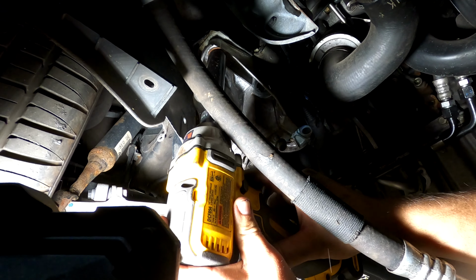Let me show you the backside here. So this is the backside of the oil pump. There would be a tube right here, the pickup tube that goes down into the oil, and it sucks up oil like a straw, flows in there. And then there's two rotating pieces that come together, and that produces the, well, it tries to compress the fluid.